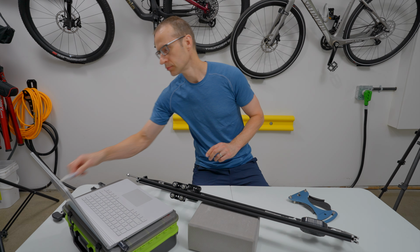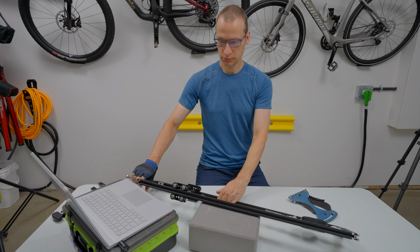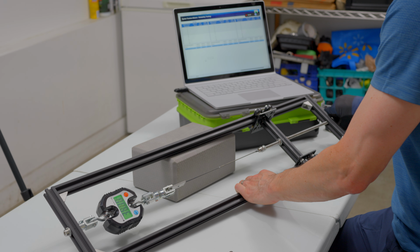My experience is that taking a tension measurement slightly above or below the midpoint really doesn't impact the reading, but there's no harm in being consistent, so I'll do it anyway. My first test of the 3-spoke meters is at 100 kilograms of force, so I calibrated my jig to replicate that amount of force. By slowly twisting the knob at the end of the jig, I'm able to increase the tension on the spoke in small increments.